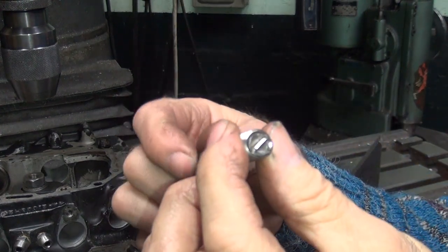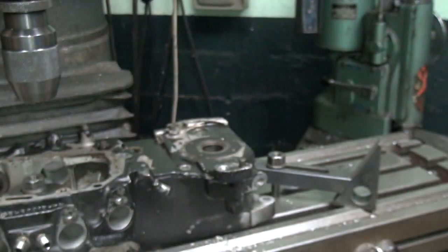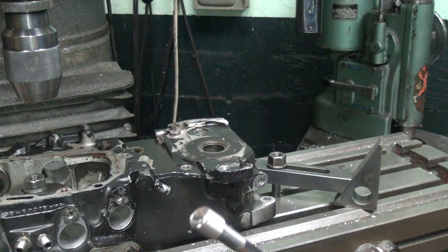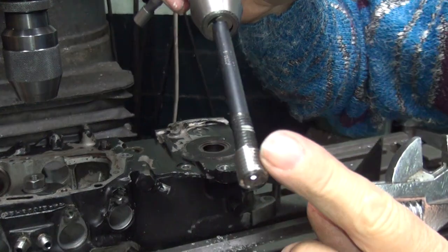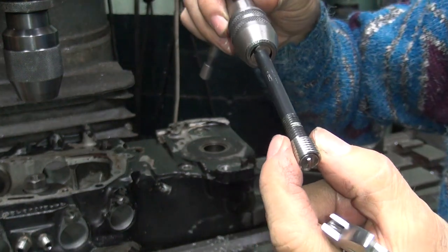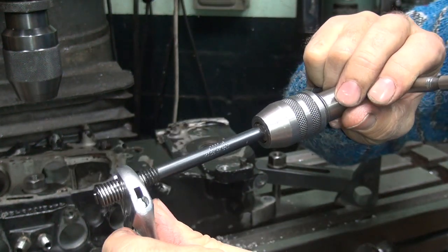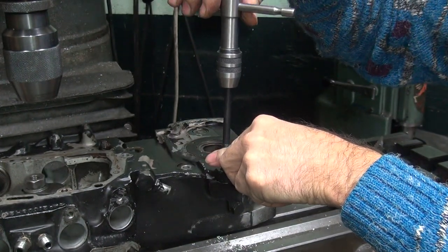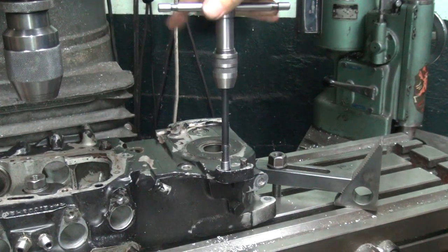Okay, so you screw this on to your insert tool. It catches a tang right there with the end of the tool. That's what rotates it in. Okay, now, tricky part. You gotta put light pressure on the insert to get it going because that's gonna collapse the OD down a little bit. Now if you push on the holding tool, it just stretches the Heli-Coil. If you put pressure on it with your crescent wrench here, you just rotate it down until it hits on the thread. There. Now you can push on the Heli-Coil directly and put the pressure you need on the Heli-Coil, but not on the tool. And as soon as you feel it go the first thread, you stop. And then you just go ahead and jam it on in there.